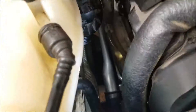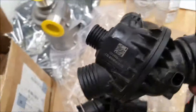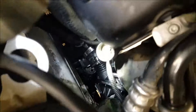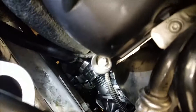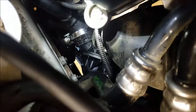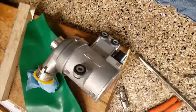So this thing is different from all the other videos I've seen — the other one had mounting holes for bolts. This thing needs to come out the top for sure. I just got the electrical off, and it looks like I can just maneuver it right over here and out. There it is — it's just a different part from the slightly earlier N55 cars. Installation is reverse of disassembly. I got the two quick disconnects back on to the new thermostat and plugged in the electrical — one quick disconnect from the bottom and the big one from the top. Now it's just a matter of getting the rubber hoses back on and clamped. The thermostat's in and all the hoses are hooked up.